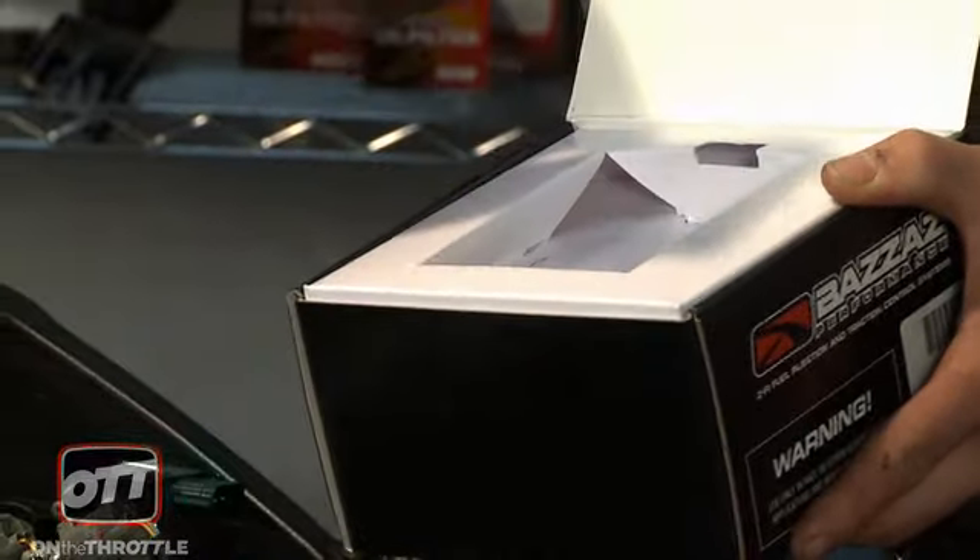My personal preference is to just flat out remove it. That way you won't drop a screwdriver onto the contacts, or some mishap will blow a fuse or anything else like that. You may choose to do it your way, but personally removing the battery makes me feel a lot safer doing electrical work. Make your decision before you progress on with the job. Clearly we have a lot of wiring here.